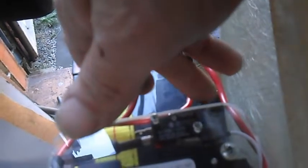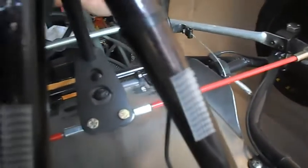Alrighty. So before we fire up the system, hit our pre-charge, about 10 seconds or so. Flip the breaker on and connect our meter. Our meter is showing we have 64.24 volts in the battery pack currently. And our switch is still off, so nothing happens with the throttle pedal so far.